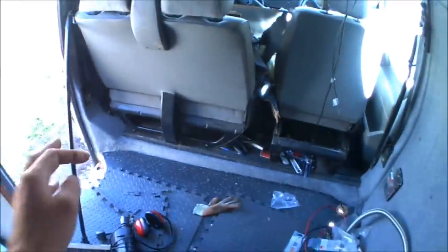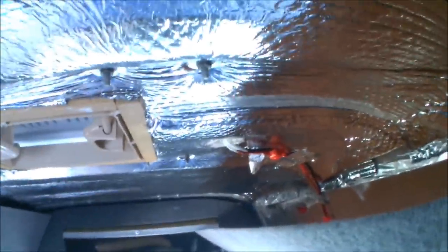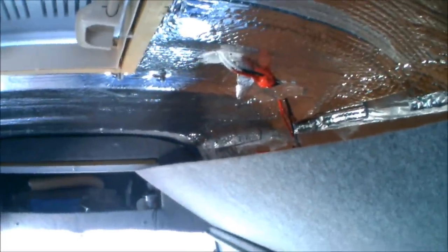The other bit I did was also around the sliding door - I've done exactly the same as what I did with the seatbelt pillars. I peeled away the rubber for the sliding door, trimmed the carpet going all the way down to where it actually sits flush with the panel, then knocked the trim back on and it gives a nice neat finish again. So that's all of the metalwork around the sliding door - the step, seatbelt pillars, runners, rear door, everything done. The only thing I need to do now is fix everything in place for the headlining. I've got the main headliner to go up, and now I've got my solar panel stuff in place as well - so once all that's in place I'll have a nicely carpeted, fully carpeted out van.